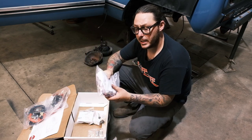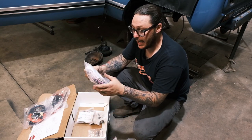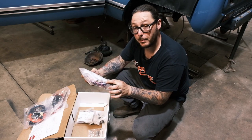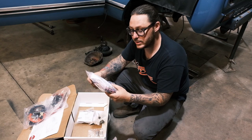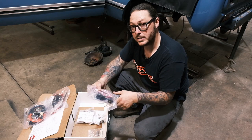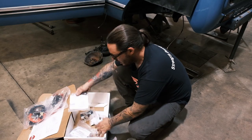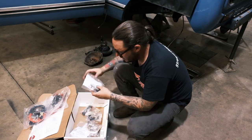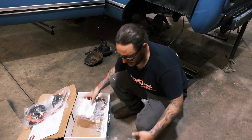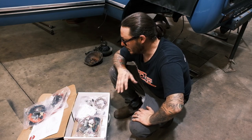This is a gauge cluster kit. This actually plugs into existing pre-terminated wires on the dash harness side. And this basically allows you to either wire in the factory gauges. They give you a complete pin out, the proper Molex connectors and pins to run the factory gauges, or you can not terminate the ends of the wires and you can put ring terminals on to run aftermarket gauge panels. So that was a really nifty little piece. They actually include a new headlight switch and a new dimmer switch in the floor, which are always components that you need to replace, or I do anyway. So yeah, really well thought out and really planned out kit.